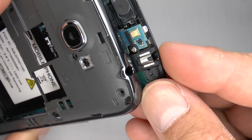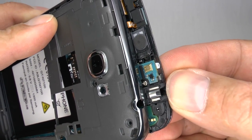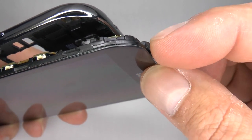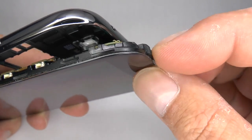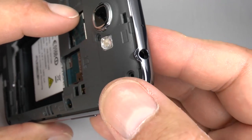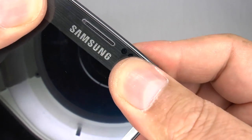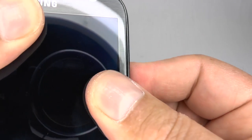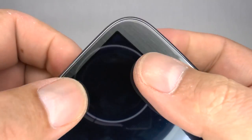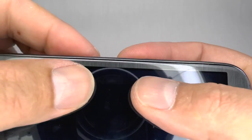Start at the headphone jack. Sometimes this headphone jack — the rubber gasket comes off and it looks a bit like this. Make sure it's pushed all the way back on and it's sitting down nice and flat. Bring the casing down onto the headphone jack, and as you squeeze it you'll see the gap close off and it'll snap into place. Keep coming all the way around the edge, squeezing until the gap disappears around the edge.